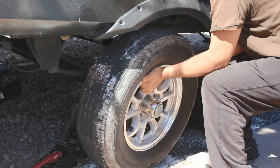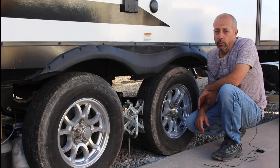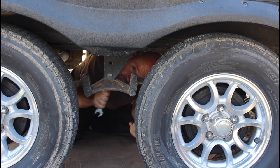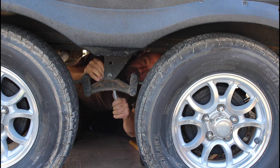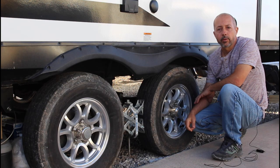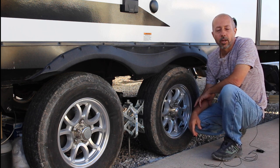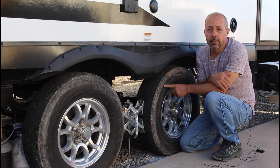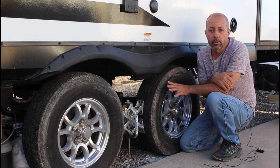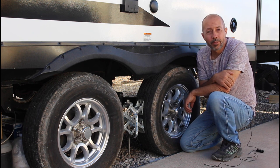The job wasn't complicated. The most difficult part was breaking loose the old nuts — and my RV is only about three years old. One nut in particular took me over an hour to get loose; I made the mistake of rounding it and finally used a pipe wrench to get it off. Now we feel like we have some peace of mind knowing our RV suspension will be stronger and hopefully last us many years to come. Heavier-duty thicker shackles, bronze bushings instead of nylon, and easy-greasable bolts — a big improvement over the stock model. This is a basic upgrade that I highly recommend.